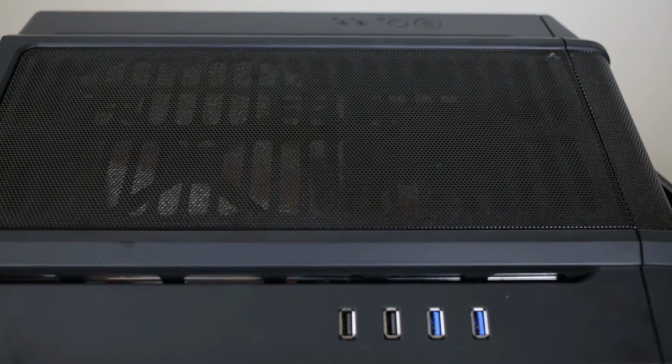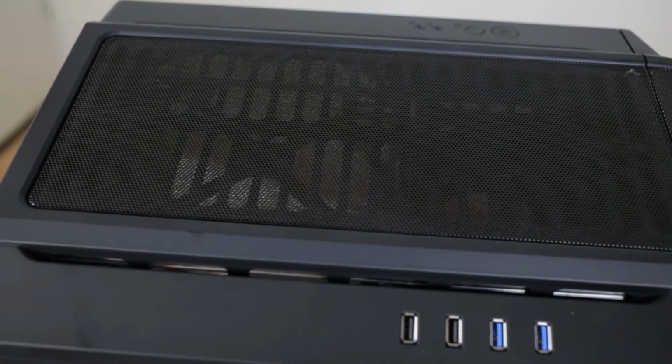A couple of tips that Raijintek could have used is that the radiator could have been placed on top of the actual filter at the top, with the fans screwed underneath inside the case, and then the radiator would be all on its own at the top. That means you would have more clearance just by using an extra half a centimetre at the top, and you'd be able to fit the radiator in there no problem, and then put fans in there. But I can see what they've done there as well, because then you won't have the option of turning it into push and pull, or exhausting the heat out or taking cold air in from the top. So technically it's okay, but they could have worked a little bit more, because on the roof of the case it's got a bump, which means you could definitely put a 240mm rad in there no problem.